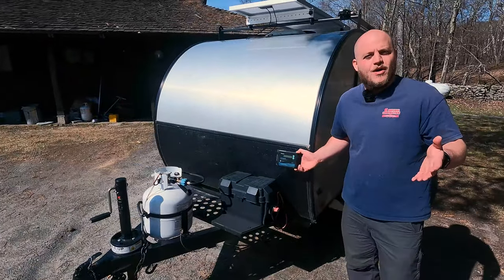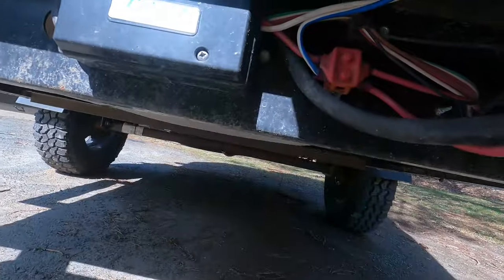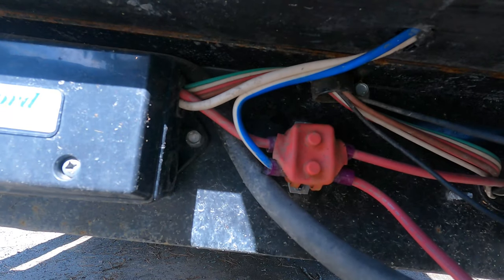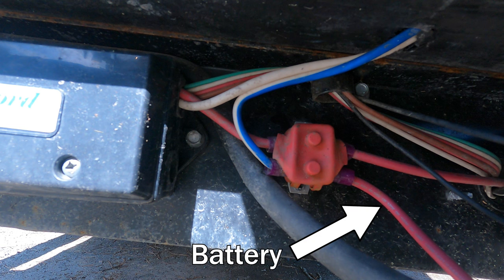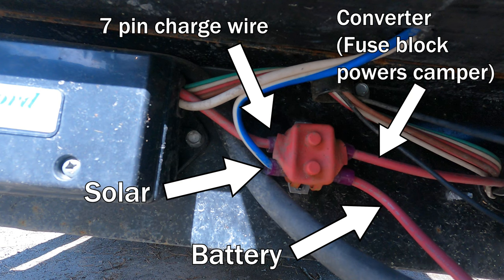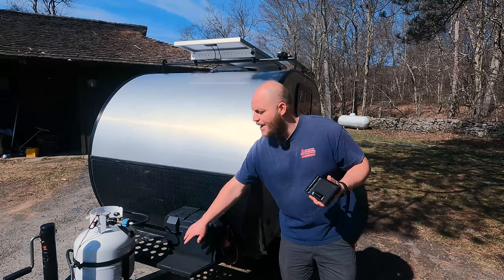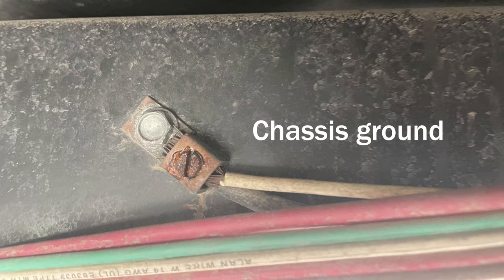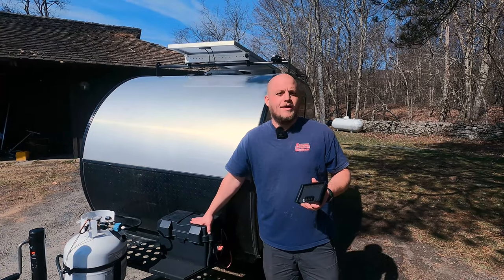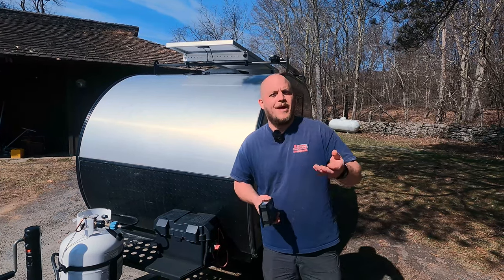The third way I don't see used too often but it's really nice: you can drop a wire down to a splice block that's very common on the front of these campers — this Bushwhacker has one. That's where the positive to your battery goes. There's a connection to your converter inside, and even a plug where your seven-pin comes in from your tow vehicle. It's easy enough to just put your positive wire on that block and ground it out the same way your battery is grounded to the chassis. That way you can avoid extra wires going to the top of your battery and avoid corrosion issues when your battery off-gasses.